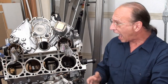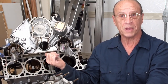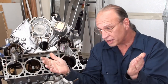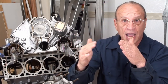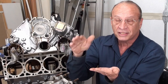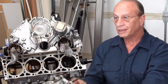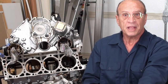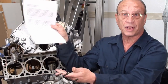So I'm going to try to get that all figured out and resolved. I have to bring it in, and there needs to be some professional equipment to see how deep that is, how long that is, and whether the rings are spread far enough apart that we're not going to get blow-by and compression loss. Maybe between the honing process and a lapping process we'll be within tolerances, and then that's all we have to do. The guy at LA Sleeve said he'd hone all the rest of them for $100, so that part could not be that expensive. So, let's see. I wrote down all kinds of things.